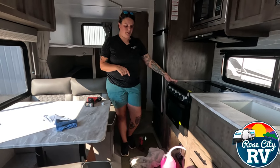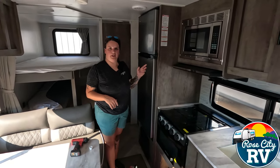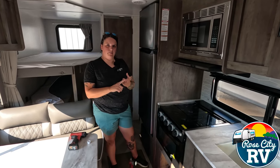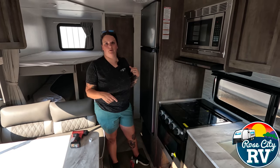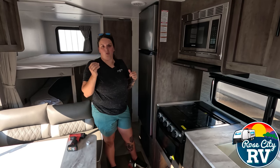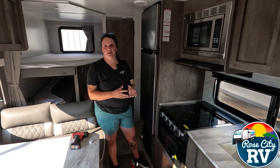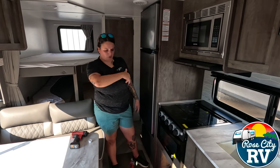Before we start to draw antifreeze, there are a couple of things I want to go over that this coach doesn't have, but you might run into. Residential refrigerators — a lot of them in motor coaches and big fifth wheels — have water filtration in them as well, which you'll want to take out. They also have ice makers, so you'll want to cycle those fridges and get that ice maker winterized — that's a big one people forget. And on washer-dryer units, if you have a washer, it needs to be cycled through with antifreeze, just as you would in a home. So look for those before we proceed.